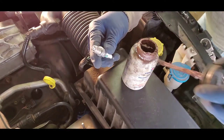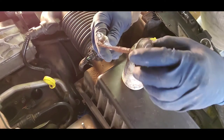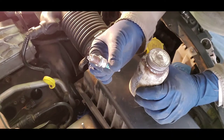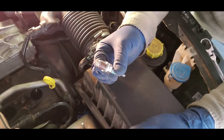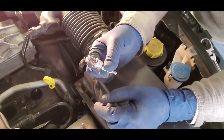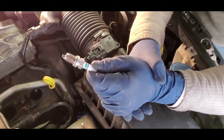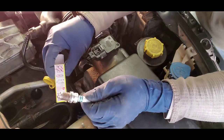Put a little copper paste on the threaded portion, distributing it evenly around the threads — this is especially important for aluminum cylinder heads. There's some already in there so I don't have to be overzealous. That's good to go — slap that puppy in there and it'll come out with ease next time. I live in the northern part of the country with a lot of salt and ice, so I always put anti-seize on my fasteners and mating surfaces, including spark plug threads. Thread it in and tighten it down — hand tight plus a half or quarter turn per the box specifications.